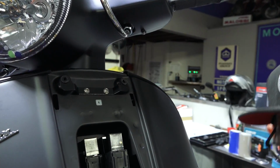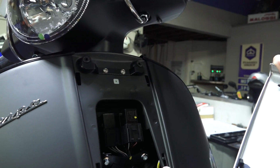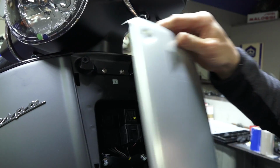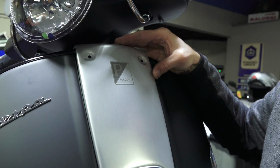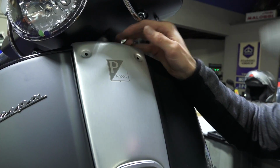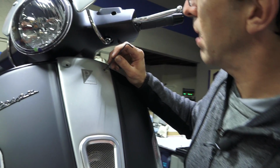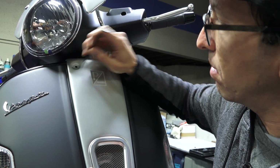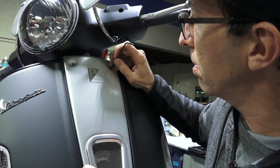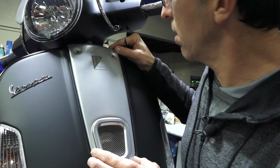Now we'll take the horn cover, and much like the original horn cover, it hooks into these lower two latches here, and we'll go ahead and engage it into those lower latches and judge where the screws go. One trick to doing that is you can look down the holes and use an Allen key to kind of steer the bracket where you want it. So I'm pretty close right here. Make sure the cover's all centered.